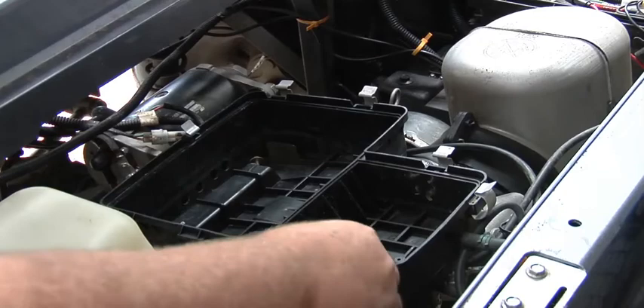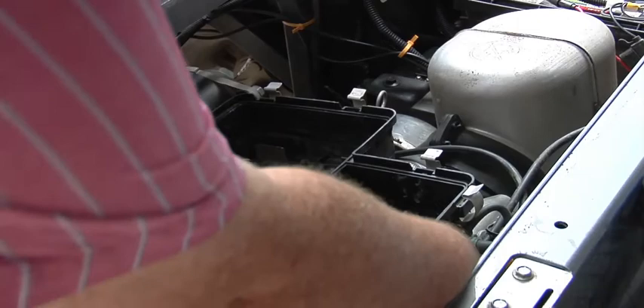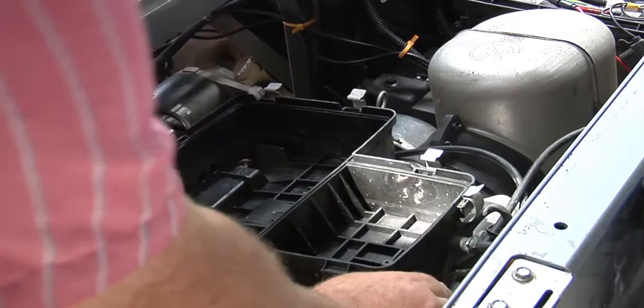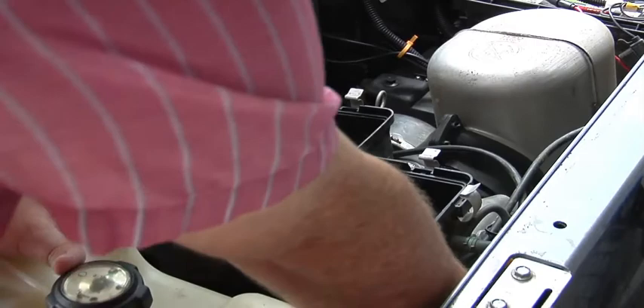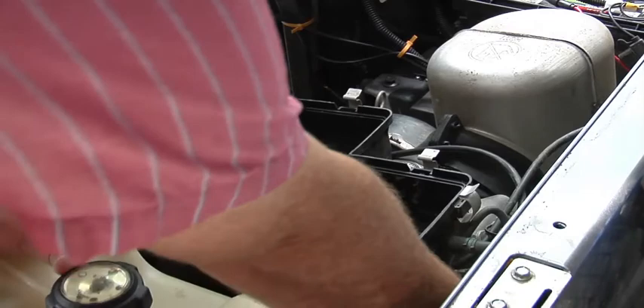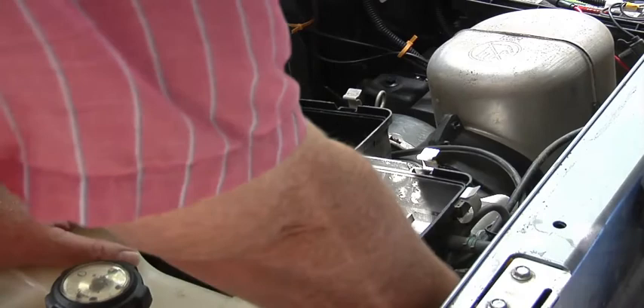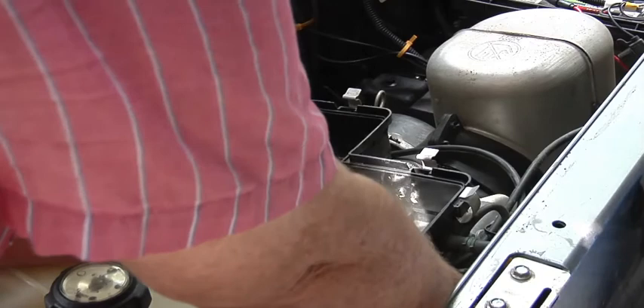People that probably seen my tune-up video just a few episodes back are probably wondering why I'm swapping out the carburetor. Well, it's just not running quite right — it's still acting like it's running out of gas. I did a flow check on the fuel pump and it's giving out plenty of gas, but it's still acting like it's running out of gas. Either a float is sticking, or maybe the fuel pump isn't getting enough gas. This swap will definitely let us know whether it's the fuel pump or the carburetor.